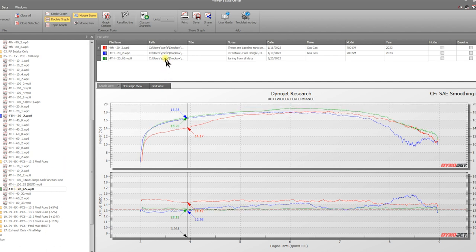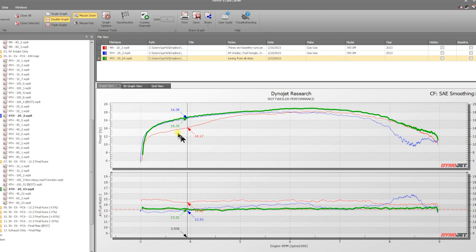So you can see this nice, now we're cooking with grease. Now you can see this nice smooth curve right here at 20% throttle. That's like cruise range, when you're just cruising down the highway or putting around. We still see a good gain on the bottom here, but you can see right here where the 690 map started to taper off and get leaner and leaner and lose horsepower, which is basically matching this line right here. Shooting for 13.2 air fuel ratio, this is a really good line that we made. What that does is it carries us over and really starts to make some good horsepower. So we've got some good gains throughout, no losses, and we've built a great map at 20% throttle.